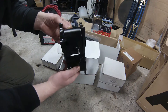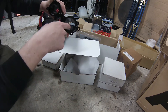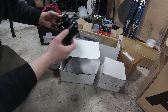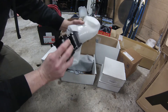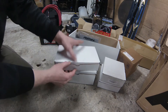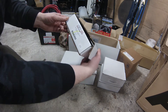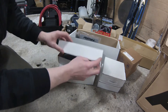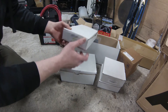The TGV deletes — they take out the tumbler valve that's usually in there. A lot of guys, I've actually done it before where you just get a set with the shaft pulled out and the butterfly valves taken out, and use JB Weld to epoxy them shut. But these are the actual deletes, which just makes it a really nice clean look. And then this box here is actually the 8mm phenolic spacers from Grimmspeed — just gives you a little bit of extra room under the intake manifold and doesn't allow a lot of heat transfer up into the intake manifold from the cylinder heads.